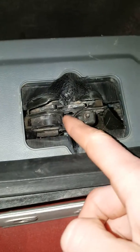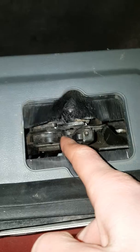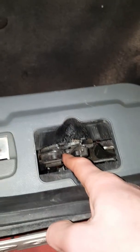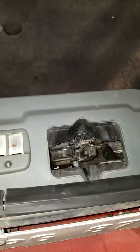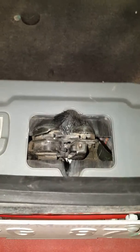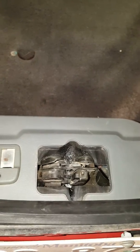The way this works is the latch comes down, latches into here, and this little switch is held down by the latch. You keep pulling it down and it stays held down, and then when you let go — say to open the latch — it pops back up again. And that little clicking you hear is another limit switch that just moves up and down between two little pieces of metal to let the motor know when to stop.